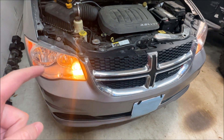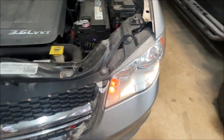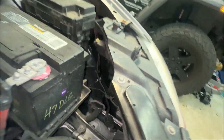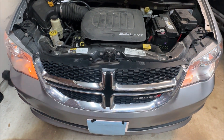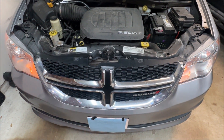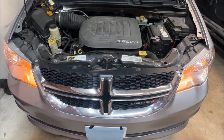That new bulb is in place — it is working. I've got the parking lights on and the turn signal, and both filaments are working just fine. Going back over to the driver's side, it's working as well. If you do need to work on the driver's side, it's just as easy — that turn signal bulb is right here closest to the engine, very easy to get to. The rear ones are pretty much the same; you may have to take the tail lamp assembly out, which is usually just a couple of fasteners. This is a very simple task you can definitely do yourself — get the bulbs pretty cheap. If the video is helpful, give it a thumbs up, subscribe to the channel, drop a comment, and until the next project, take care!